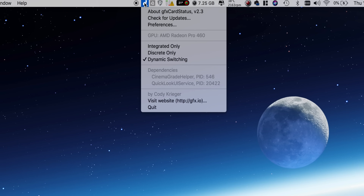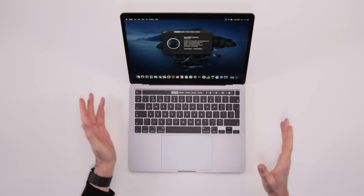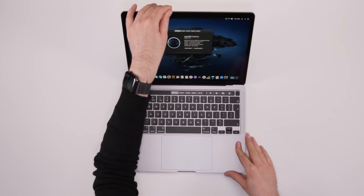Fun fact: since you only have one integrated GPU inside this one, the battery life will actually last you longer. On a 15-inch MacBook Pro, lots of apps force the dedicated GPU, and unless you have a tool like GFX Status to monitor which GPU is being used, you wouldn't know. Battery life with the dedicated GPU active is significantly worse. So having only integrated graphics here is actually a battery advantage.